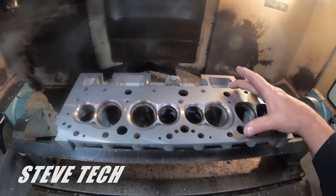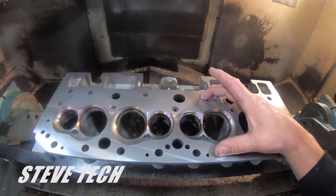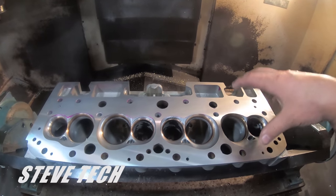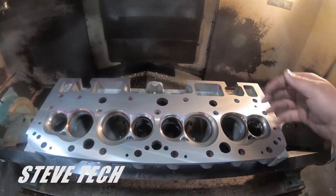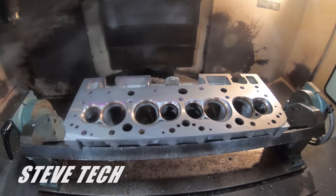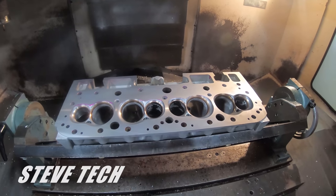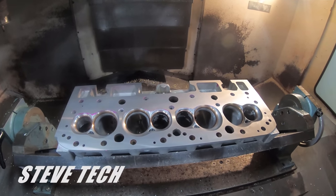Make sure you have a very good, fine surface finish in that 10 RA area, and make sure this stuff is flat. In a future episode we'll cover how we do combustion chamber modifications for boosted applications — how that changes the way the flame front crosses the combustion chamber. We'll also show you how we do a one-piece stainless steel hoop machined into the cylinder head, versus old-school wire, which is just not nearly as good. Anyway, this is why we resurface cylinder heads and blocks — they don't come final-surfaced from the manufacturer. I'm Steve Morris, Steve Tech Videos — have a great day.